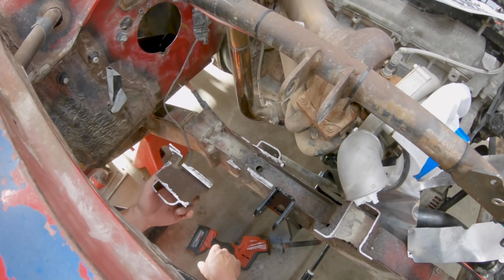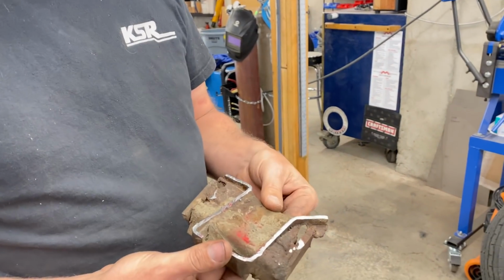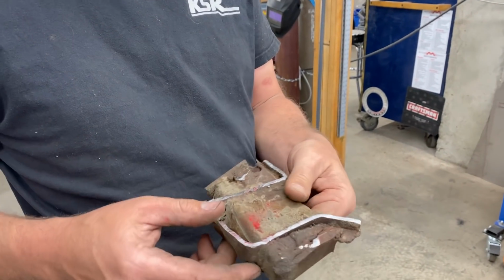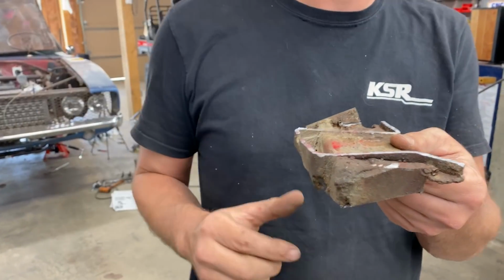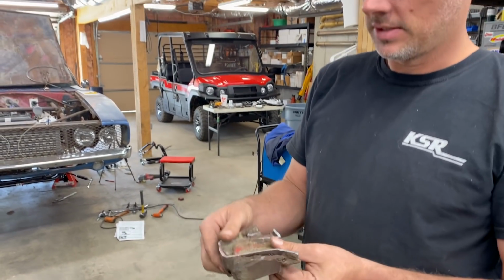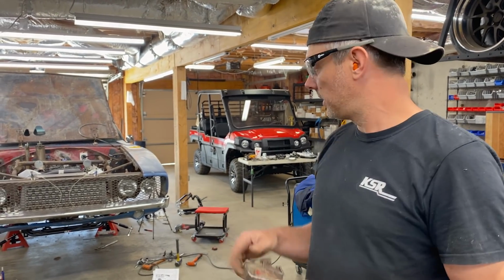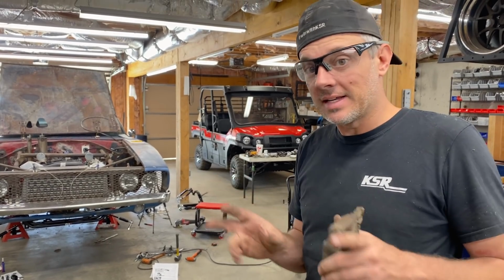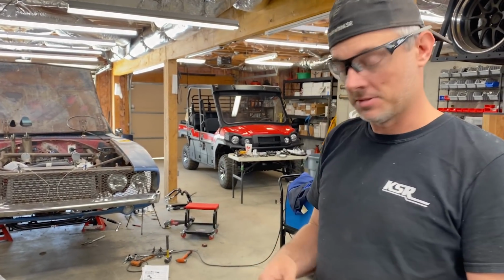Dang, Joe Barry. From what I think I'm looking at here, this is the original frame rail. And so you can see this is not stock material. That's not stock material. So there's that much thickness added on top of your original frame rail. Right. So all in all, I took about 1 1/4 inch, 1 3/8 out by the time I've fit all that. And then what I cut out of the front bucket that you're about to work on, we'll tack it together, see if the sweep looks better. And then if it is, fully weld it in and then do the other side. I like this. I think it's going to work great. I hope so. I have all the faith.